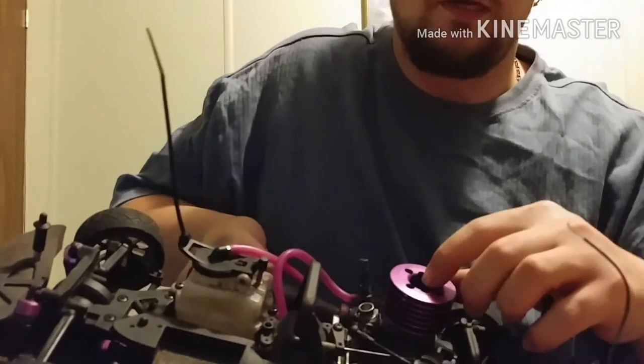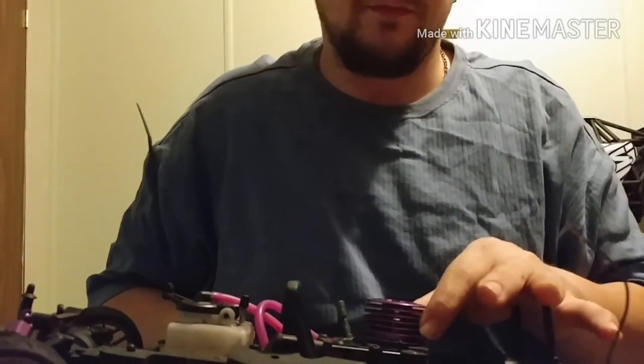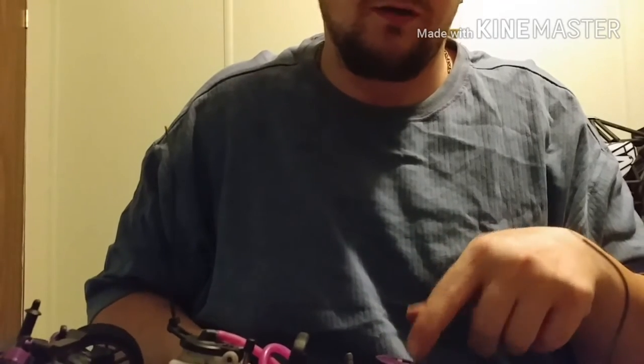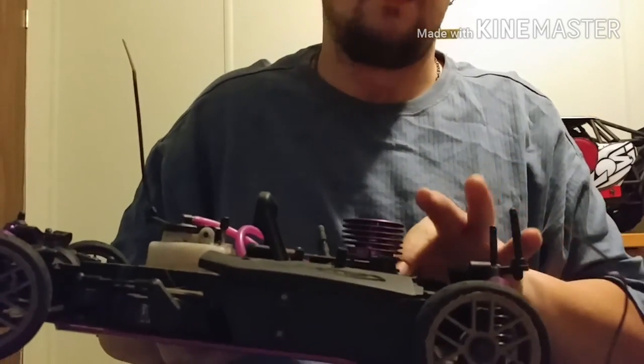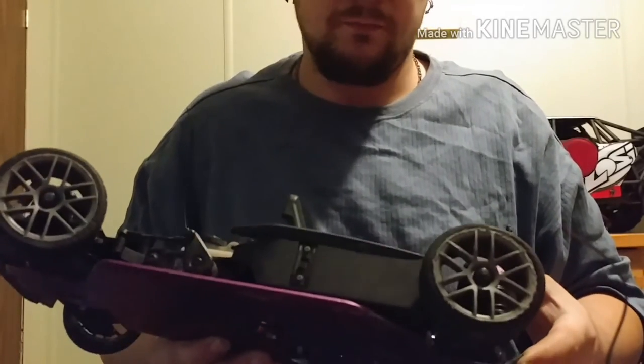With a vehicle like this, I could take this wire and wrap it around the top post. There are two ways you could do it, but the best way would be to touch it to the side of the glow plug. You can also ground the negative side out to the engine block, and that will also get it to glow. Like I said, I've seen a lot of people use four double-A's — that is a very quick way to blow your glow plug.